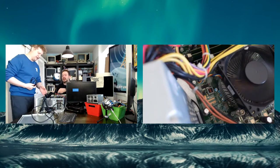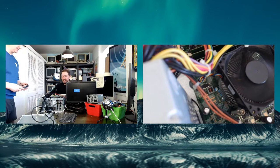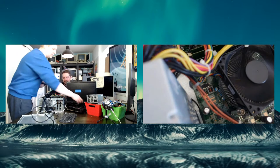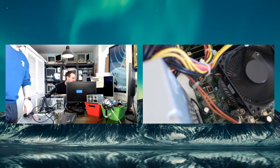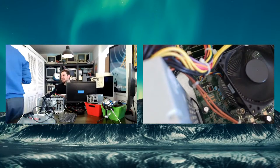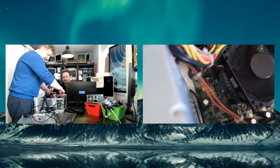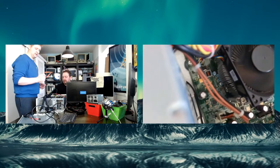I don't think we have. I don't think we do either. Unless, by chance, do you have SATA to Molex? Have a SATA to Molex deck you're just kicking around? I really don't think so. Because that would be the real jank way to do it. SATA to Molex, then Molex to 6-pin, then 6-pin to this other 6-pin. Don't hot swap. For interest's sake, though, that's gonna work for going over the graphics.